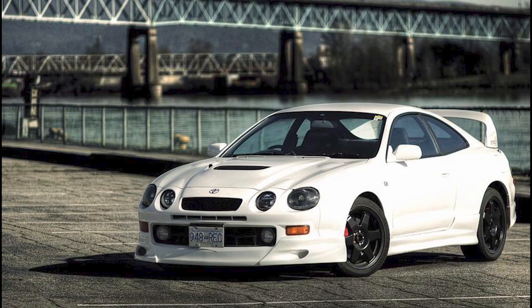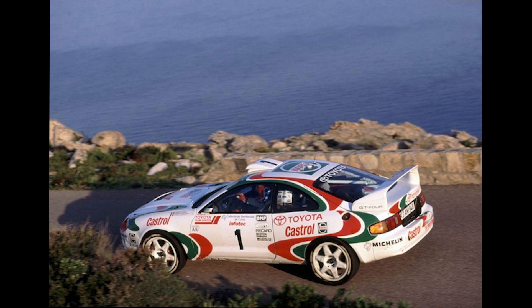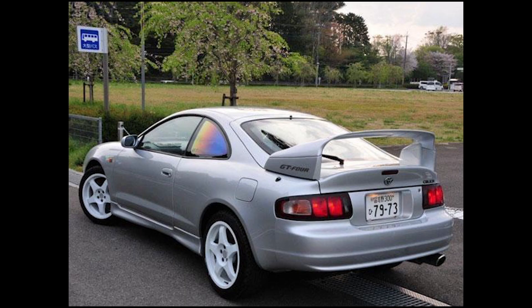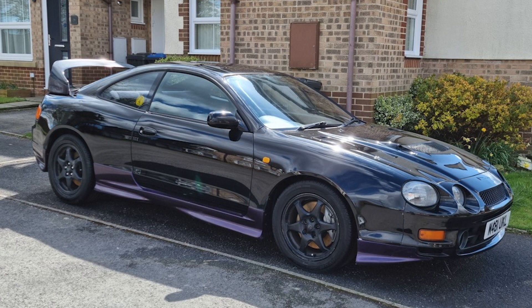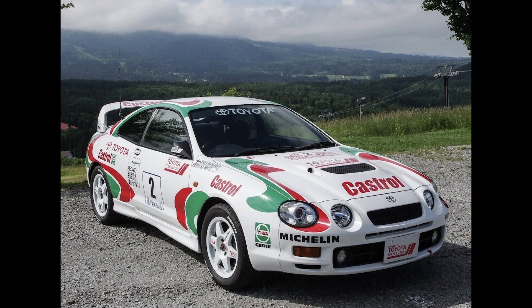So I'm looking at different alternatives and I have three objectives. The first one is I want the ride to feel more supple and more comfortable. We have crappy roads here in the UK, and this is a rally car — I don't want to be on low profile tires. I'm currently on low profile tires and I've made the missing suspension changes, going back to OEM suspension. That's improved things, but I'd like a thicker sidewall, and also the wheels are quite a bit lighter — 16-inch compared to 18-inch will give me a weight saving, reducing unsprung mass and hopefully making the car flow better down the road.